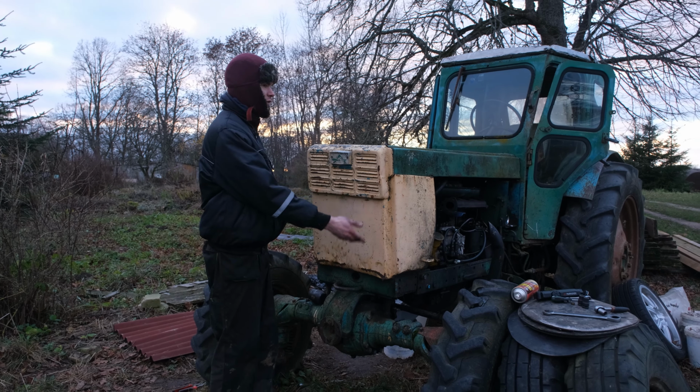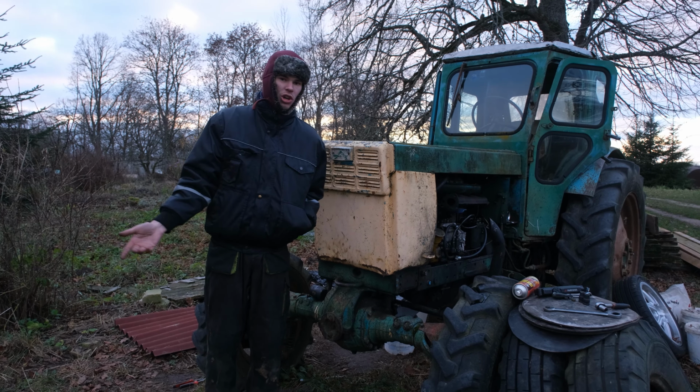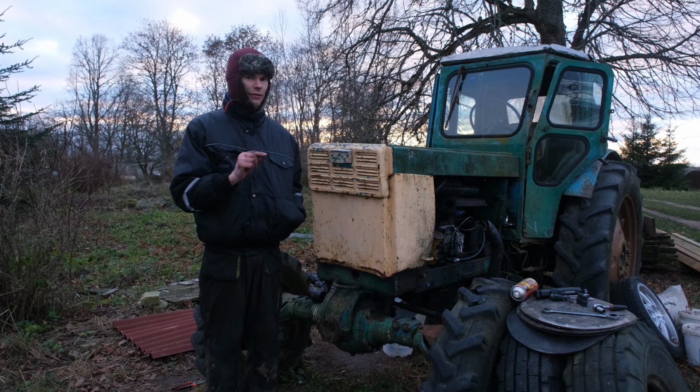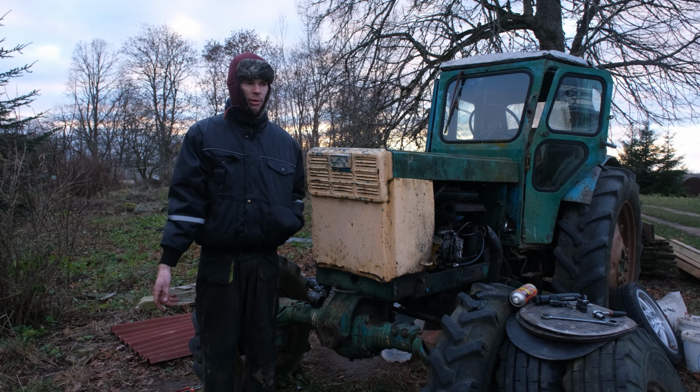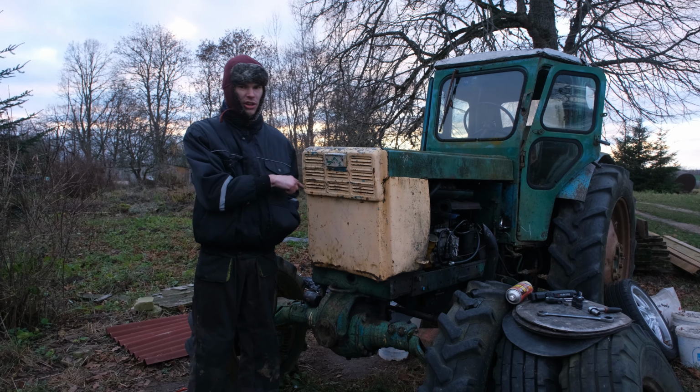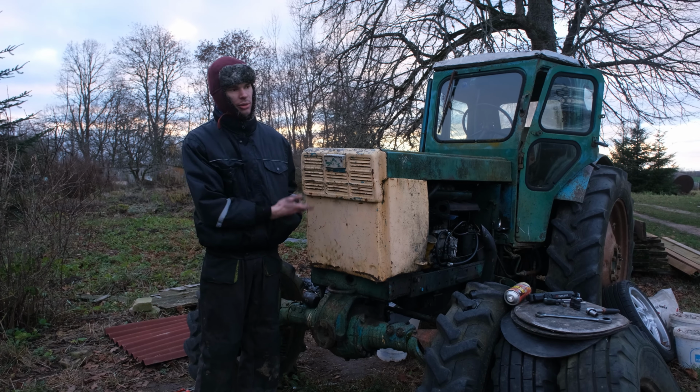We checked the fuel filter for obstructions, and there's nothing in there. I don't know. I think it is the fuel pump. It cannot be anything else. The timing of the fuel pump might be incorrect. We're going to try to put the other fuel pump on, and then we also have to fix the clutch, and then it should be drivable so we can bring Harold.